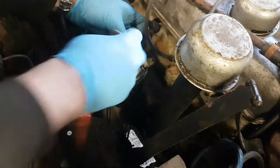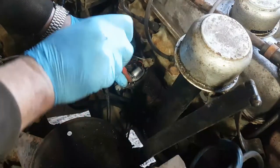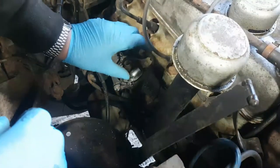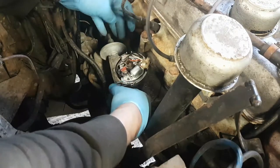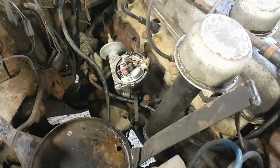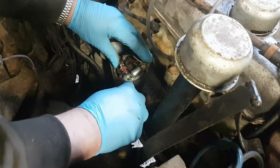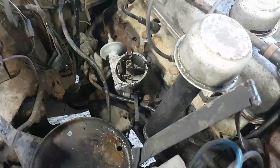Lift the little screw — don't lose it, put it on the lid of the box or I'll lose it later. And the other screw. There — you can see the base plate's loose. Now the whole base plate just lifts up out of the distributor. It's got the peg for the vacuum advance. I'm just slacking off a bit — I should retime this thing again. I'll just lift the spring off the peg, put a bit of slack on it, and then lift the base plate out. Base plate is out.